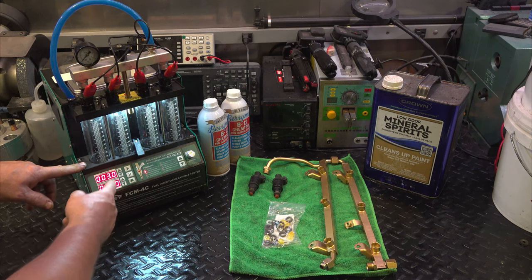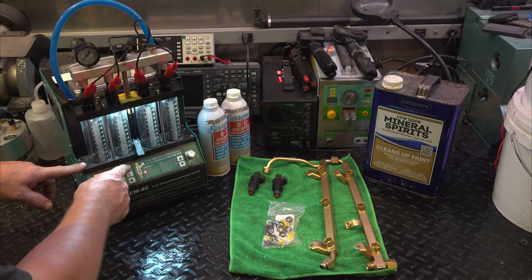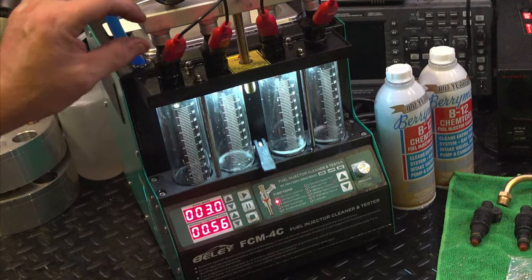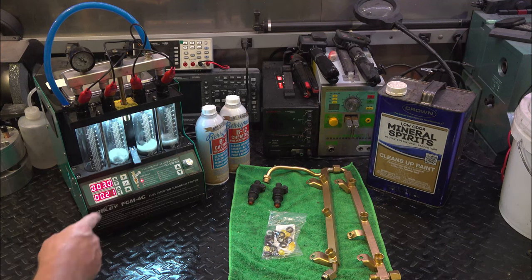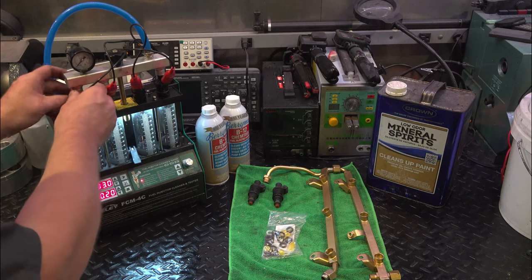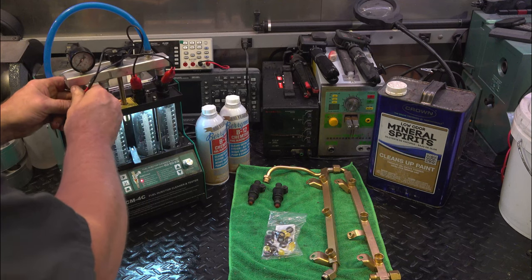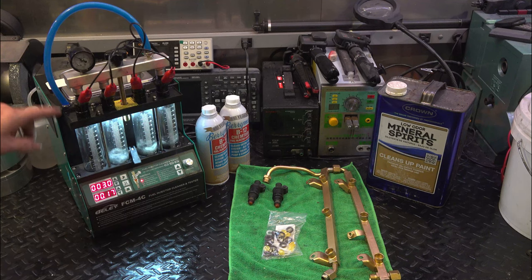Right now I'm going to turn on the pump, start filling up these cylinders. We'll just run idle speed for now and measure the volume. Okay, you can see this one here isn't working at all. That's about 50 pounds of fuel pressure. I'm going to pause this for a second — you can see this one's flowing a lot more than this other one. So I think we'll just swap this around. There's a bad cable there. This injector is completely dead, so there was a dead cylinder on that engine.